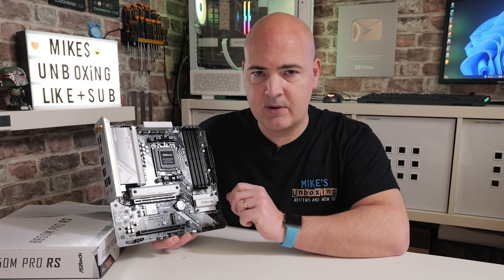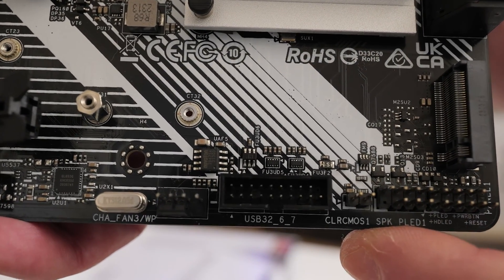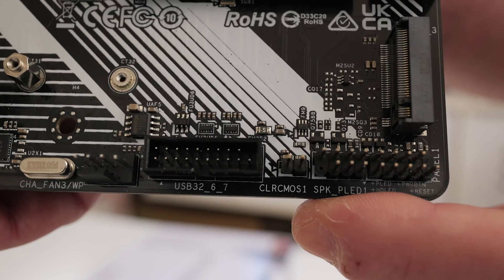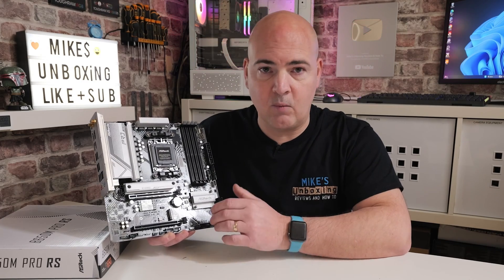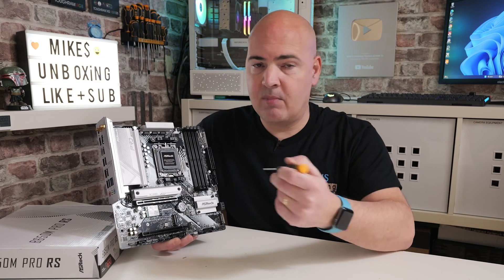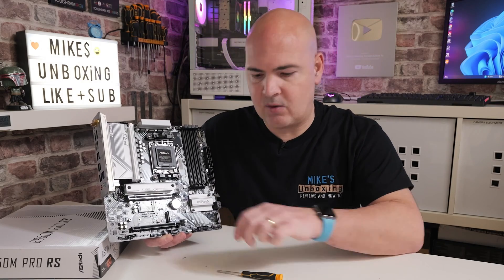The next thing is to find the jumper pins on your motherboard that refer to clearing the CMOS. In this instance it's actually labeled 'Clear CMOS' or 'CLR CMOS' — which is very obvious and says exactly what it does. Those two pins are right down at the bottom next to our I/O section. On other motherboards you may see it labeled as JBAT or JBAT1, which is quite common for MSI motherboards. You'll also need a metal implement — a screwdriver is ideal, but a paperclip works too. Specific plastic jumpers used to be included with motherboards but are quite rare these days.